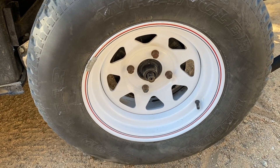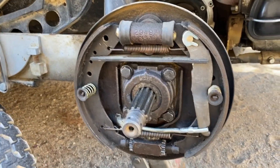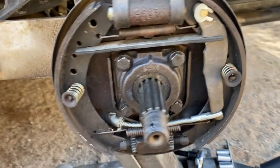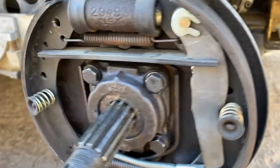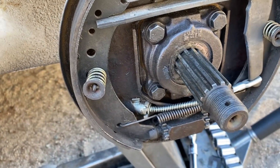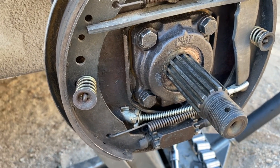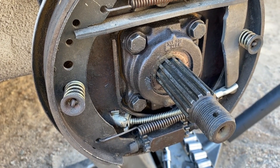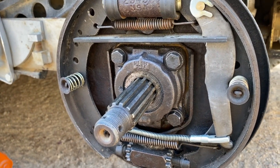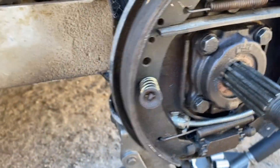With the axle nut off, I can now remove the wheel and brake drum. You can see I've got to take off these four bolts. You'll notice that although the seals are leaking, there's no oil on the brake shoes and no oil on the brake drum except for the outer edge. That's because the Germans designed this with a weep hole — when the seals allow oil past, it runs down into a little area that goes to a weep hole and runs out the back of the drum. That keeps oil off the brakes, which is a safety feature — if oil got on the brakes you wouldn't have any braking in the back.